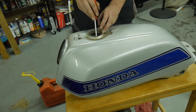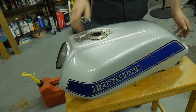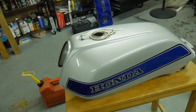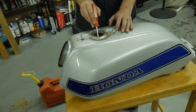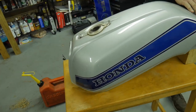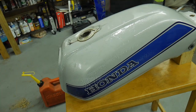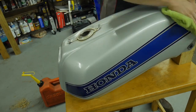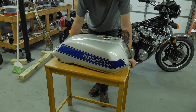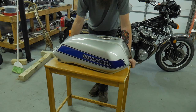Now I'm going to dry it all out again with brand new clean rags, shoving them down the corners. The gas evaporates pretty quick, and the oil in the gas really helps coat the tank and give it the best possible chance. Keep using fresh rags — paper towels tend to break up, so maybe use lint-free rags. The cool thing about the two-stroke oil and gas is it kind of helps provide a barrier for the tank, creating some kind of protection for the metal.